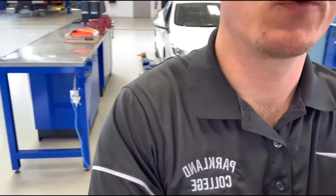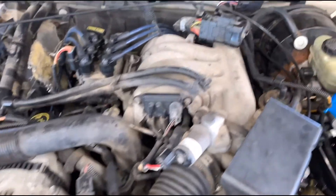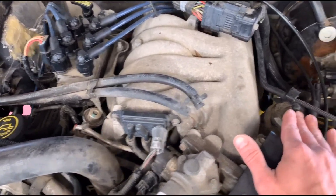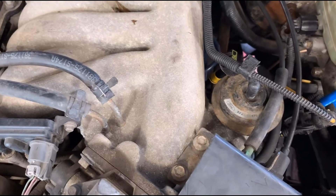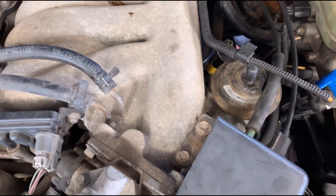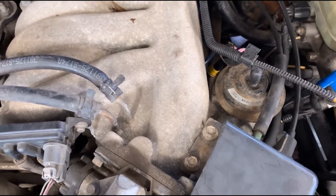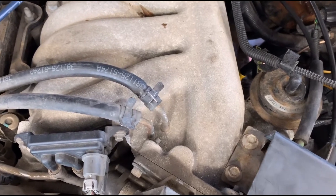If I've got a vehicle like this with an EGR insufficient flow code, what do I look for? One of the biggest issues is carbon buildup within the valve and the passageways — mechanically they just cannot flow. If I go through my tests and do not see any change as I actuate the EGR valve, there's a high probability that is my problem. At that point I remove the valve, inspect all the ports, and depending on how those ports are set up I've got a couple of options to clean them out. We'll spotlight a Honda TSB on their six-cylinders to highlight that idea.